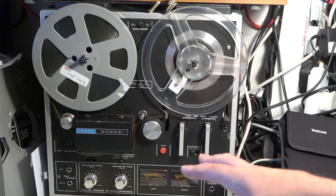Another consequence of the Akai's back tension design is that very small spools become a problem. If you had an extremely small spool mounted, the rotation near the end is way too fast, giving you huge amounts of wow and flutter — it's just unplayable. So if I get extremely small tapes on spools approaching that size, before I can play them on the Akai I have to transplant them onto a bigger spool. Strangely, this big Ferrograph that takes the big spools is actually better at handling very small spools than the domestic Akai is.